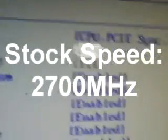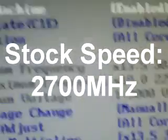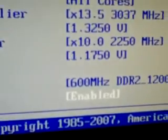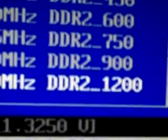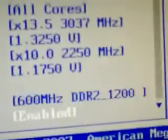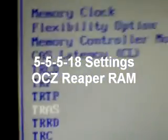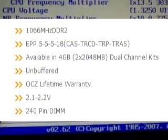Going to 225 — I hope this is stable, it should be stable. L3 allocations of course. The thing just went up even a bit more, just been overclocked to DDR2 1200 for all four gigs of RAM. Here are all the custom settings: 5-5-5-18.